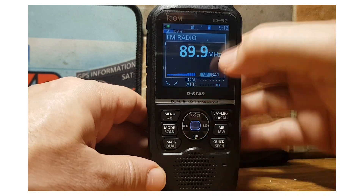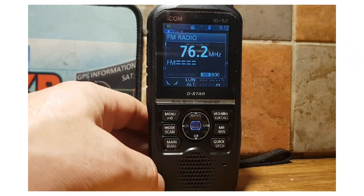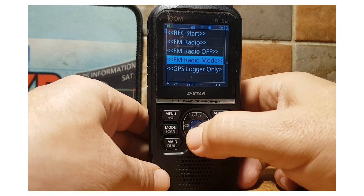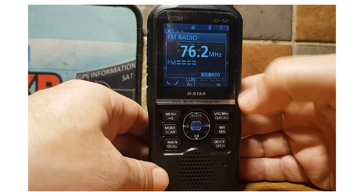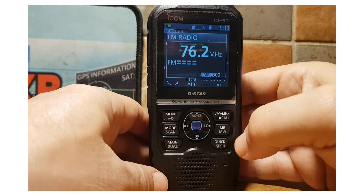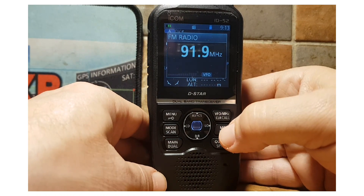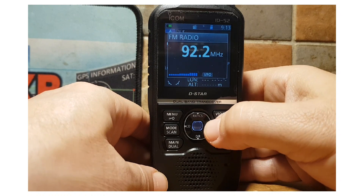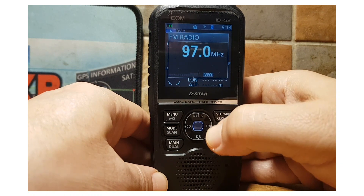Let's turn the FM radio on and scan. To scan forward, hold down the LO button, but you need to be in VFO mode. Hit VFO, then quick — FM radio on. If you're in memory mode, hit the memory button to switch back to VFO. Once it says VFO on the screen, hold down forward and it will stop when it finds a station.